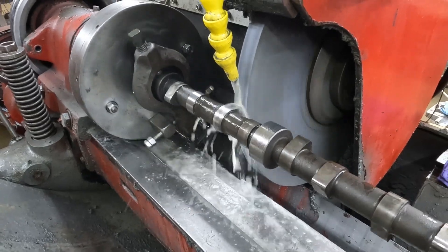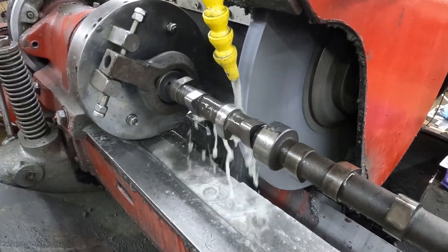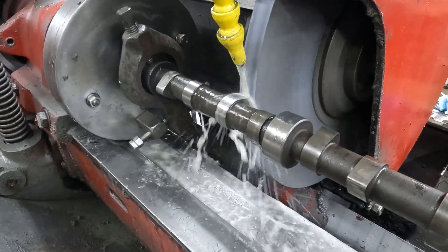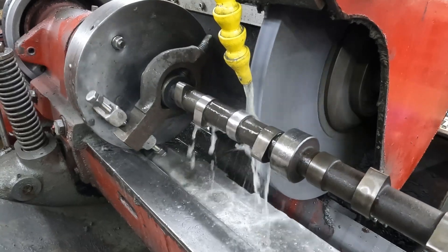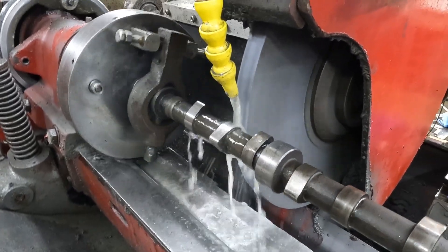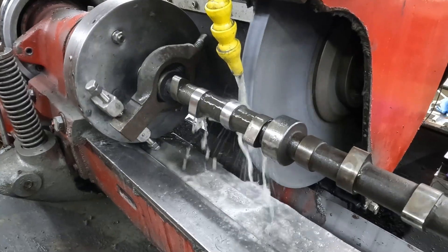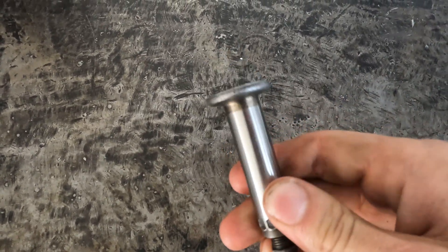Some of these old cams are just non-existent. This thing was bent 18 thousandths in the center — 18 thousandths runout on the center journal. We peen camshafts and crankshafts to straighten them, and this long spindly thing had me scared the whole time I was peening it. But we got it down to two thousandths and stopped there — I didn't want to break it in half. All five mains are within two thousandths, so it's going to live again. We also reground all the lifters; they've got huge lifters with a head diameter of almost an inch and a quarter — pretty robust.